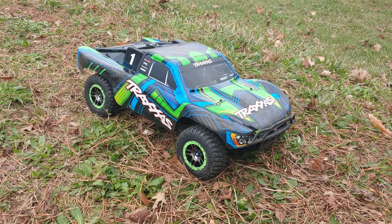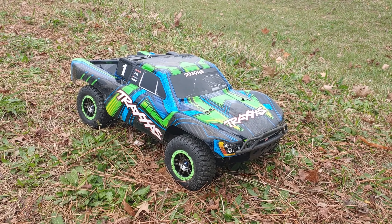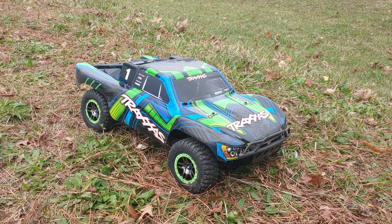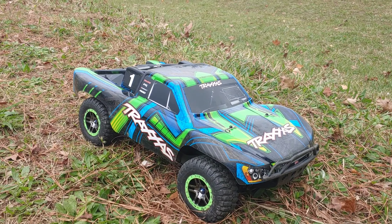I had to tighten that motor back up and check my gear mesh real quick. I'll probably have to fix the spur gear — sometimes the teeth get eaten up on there and you can basically take a flathead screwdriver and go in between the grooves of those plastic spur gears and kind of recycle it. I'm thinking about getting the Hoss center diff with the metal spur gear and putting that on here so I don't have to worry about that going forward. Anyway guys, that's a quick video — don't forget to like, subscribe, stay tuned for more videos, thanks for watching!